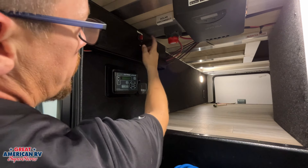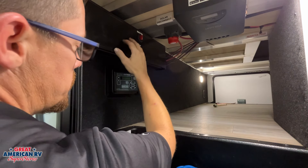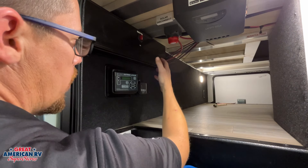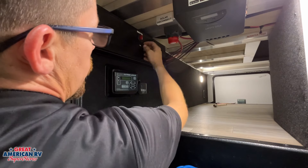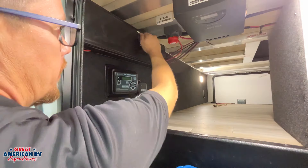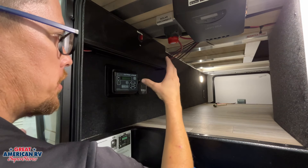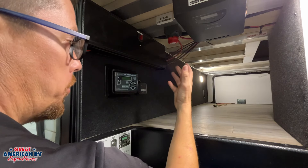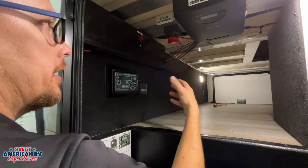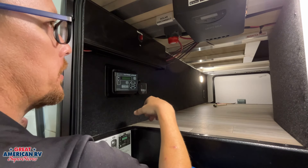In this box we're going to have our battery disconnect. You'll find a lot of resettable fuses — most are temperature controlled so they'll automatically reset after they cool off. It's an on/off switch — we go ahead and turn it off to disconnect our battery power from the rest of the unit. We use that when we store our unit unplugged to conserve battery power. When we are plugged in, using it, or storing it plugged in, we want to leave that switch on so our battery actually gets charged.